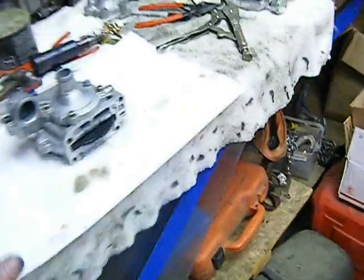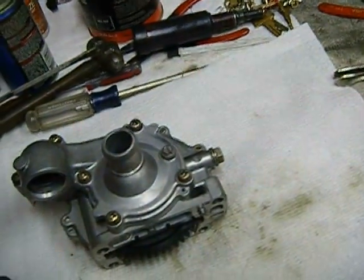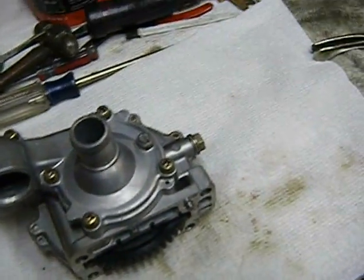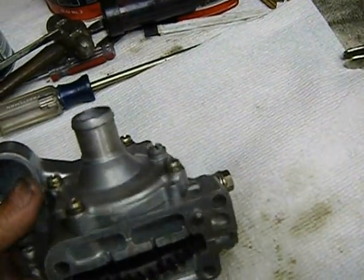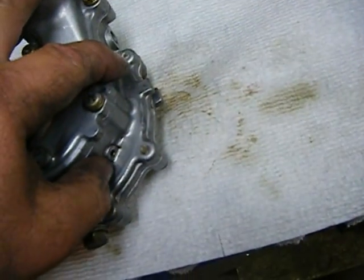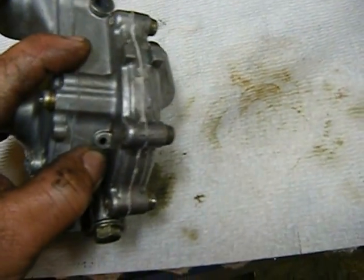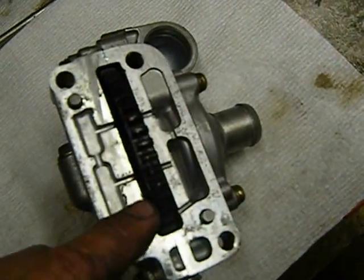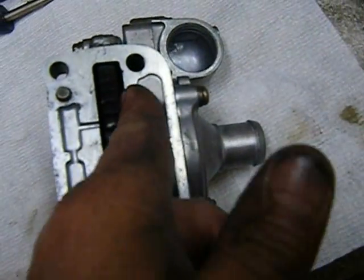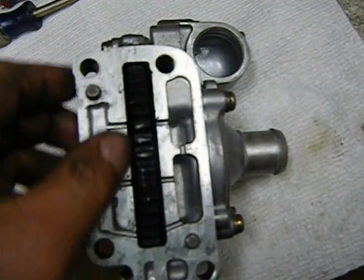One other thing I wanted to show you is our water pump. If you remember, we rebuilt this water pump, and I had some questions about it, and the questions were if there's any water that's introduced into this that goes past the seal, it comes out of this little weep hole, but if it's enough water, then it could go past the seal and inside the engine case, resulting in you could lock your engine up or whatnot.